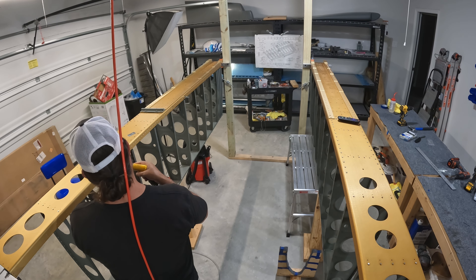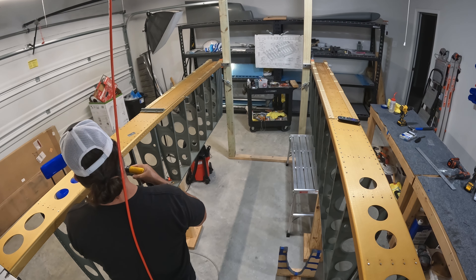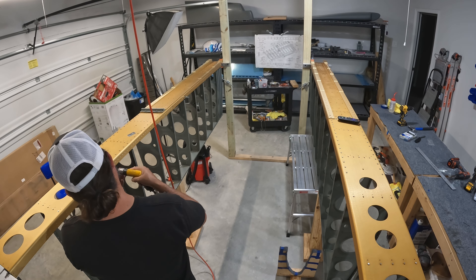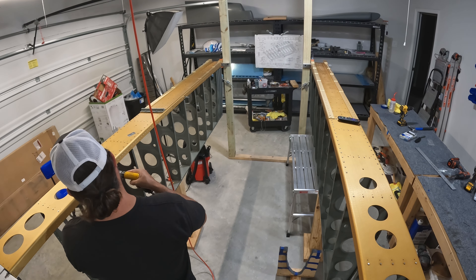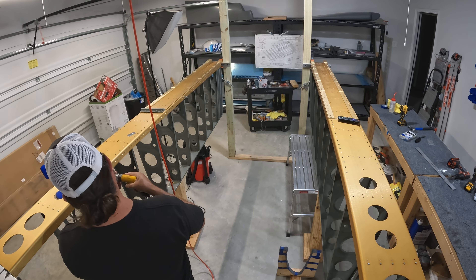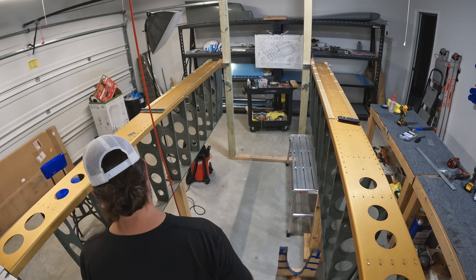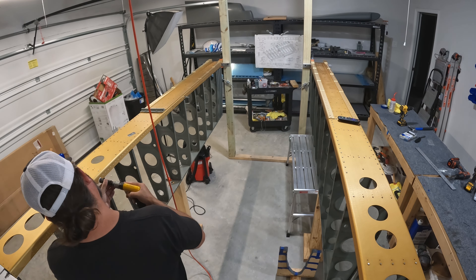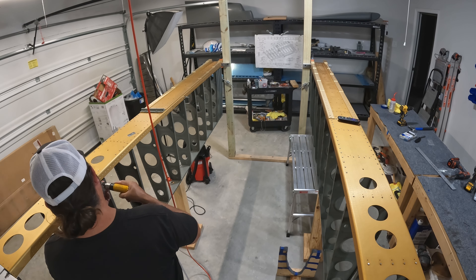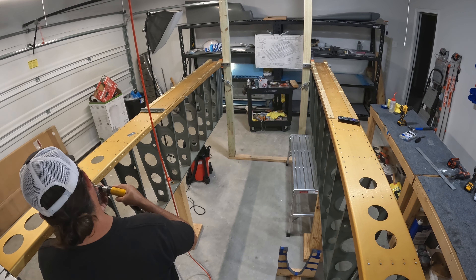After fixing the tank leaks, we'll see what else I can work on. I still have the fiberglass tips for parts of the empennage, but it's possible — I don't think it's likely — that that stuff might all have to come apart. So I guess after I fix the leaks in the tanks, I'll go ahead and inspect all the empennage parts thoroughly and get in there with the borescope and see what we can see.